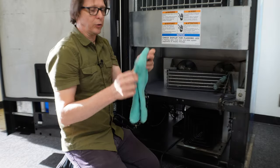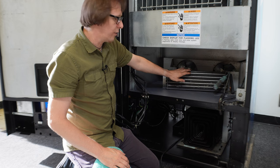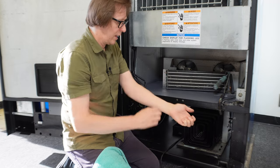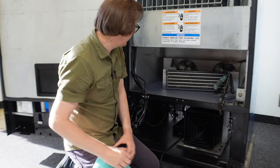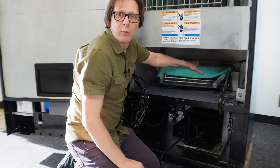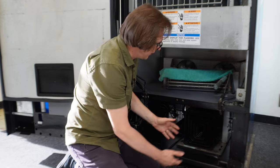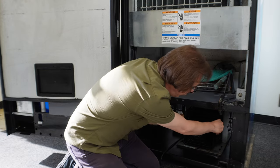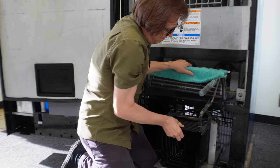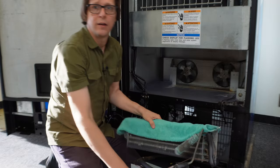This is where the handy little towel comes in. The aluminum fins on your evaporator coil are very, very sharp — they will cut you. If you're not careful, they're going to leave nice little rake marks across your arms. So I always like to take a little towel and wrap it over the top of the coil. Now I can grab it without worrying about cutting my hands or fingers. With that, I can grab the compressor, slide it forward, lift it up, and pull it out. This entire refrigeration assembly is now completely removed.